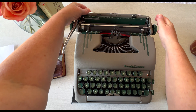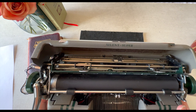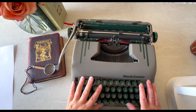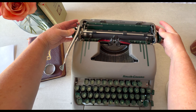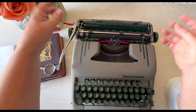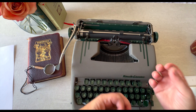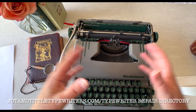We're going to start from the back. This back panel does flip open if you need to get in there to clean, but you really don't need to set anything on the Silent Super because the settings are down here. Let's start with the carriage — to move it, use these two metal levers. It doesn't matter which one you pull, but that will pull the carriage to the left. If your carriage is limp and doesn't pull to the left, your drawstring is broken and you'll need a professional repair person. I have a typewriter repair directory on my website.